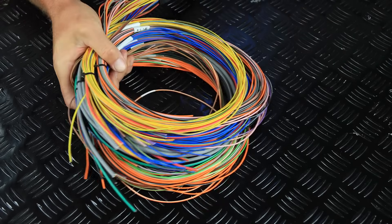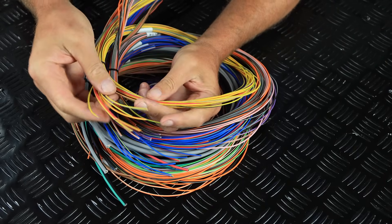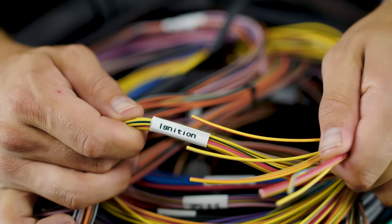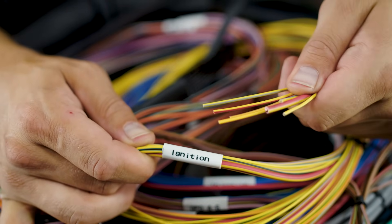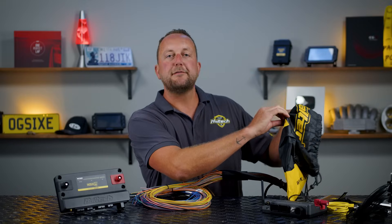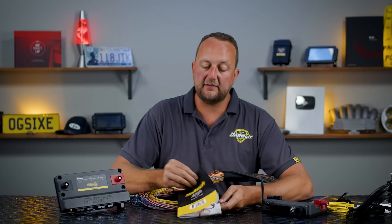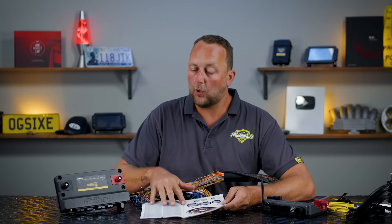The looms are two and a half metres long and all wires are colour coded, matching up with what's in our IO report — makes it nice and simple to wire. They're also grouped together, so we have, say, our eight ignition outputs paired up with our ignition power supply. Inside the front pocket of the bag there's also a quick start guide showing details about the harness, where everything's wired, and a bunch of useful resources before you embark on wiring your own car.